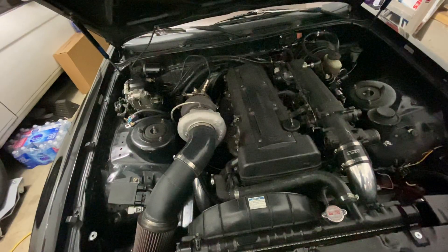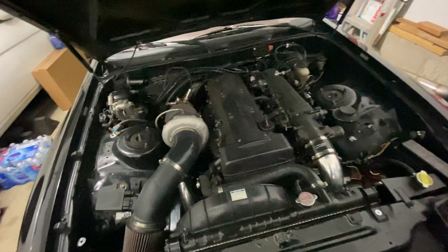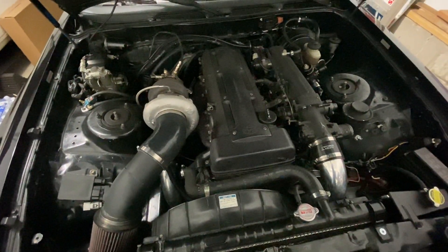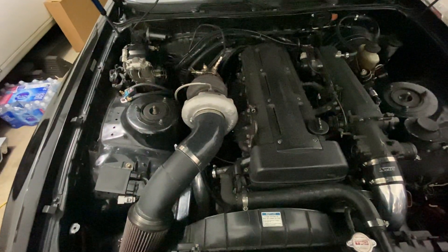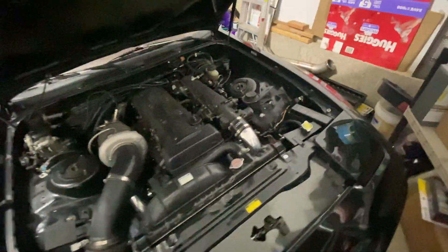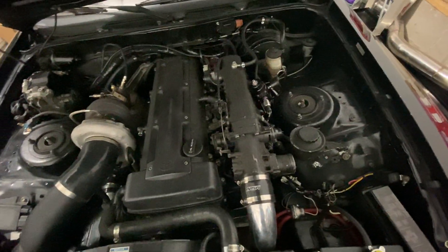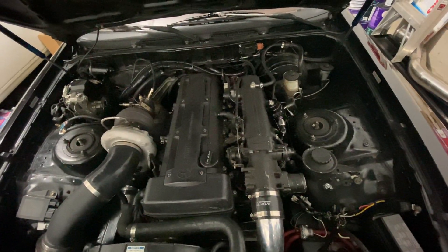My goal was 700 and I was able to hit 703. I won't be driving this car at full boost — when turned all the way up, my rear end started to give out. I have some issues with the subframe bushings and alignment after the tune — too much power. It's a stock, unopened motor. Seals were done by me. It's a turbo SC300, Borg Warner, with an eBay cast manifold, PTE 46mm wastegate, stock manifold, 1000cc PTE injectors, and a dash-8 feed from the fuel tank all the way to the rail.